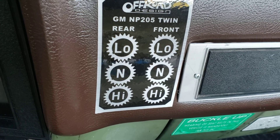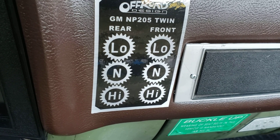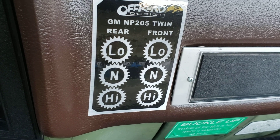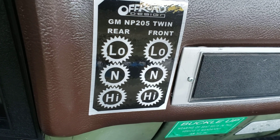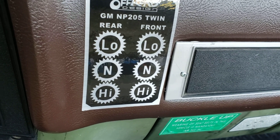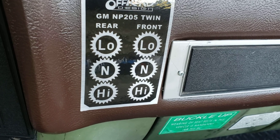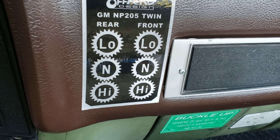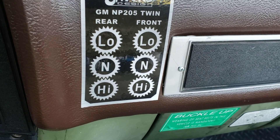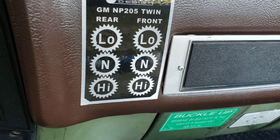Here's the shift pattern: right now I'm in two-wheel drive rear high. I can go two-wheel drive rear low for more of a crawling function. Then I can go either front low and rear low, or front high and rear high — your normal four-wheel drive high and low. But with this modification, you can actually do front-low only or front-high only. You put your rear shifter into neutral and move the front shifter into low or high. So if you break a driveshaft or U-joint in the rear, you can crawl out using front-wheel drive.